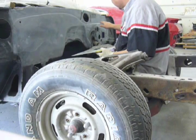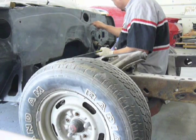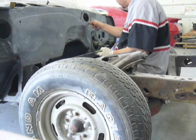Sighting down it with your grease and wax remover revealed that this little line going up here, and up here, is a little wobbly. So put filler on both sides and then finger a little more into the line.